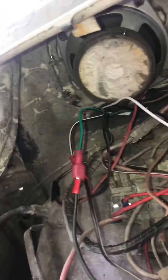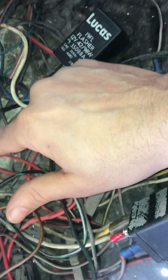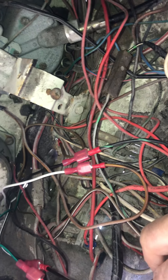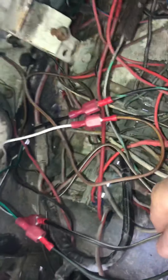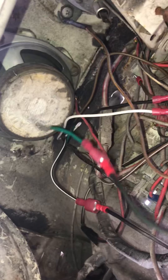Not a great video, but I've come up through here with the new wires from the new indicator stalk — the aftermarket one. I put connectors on the original wires: the green/white and black went to the black on the new stalk, the black/white went to the black/white — that was the left or right indicator. Then the green/black new went to the green/black old.